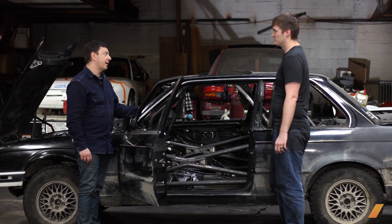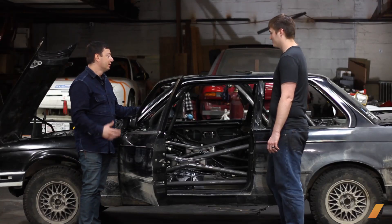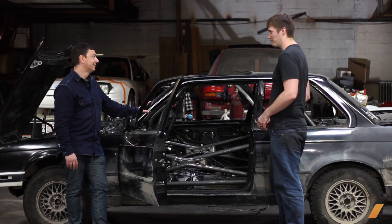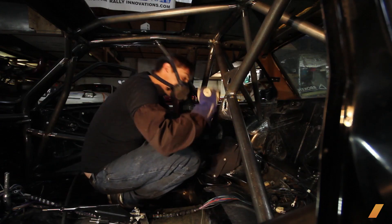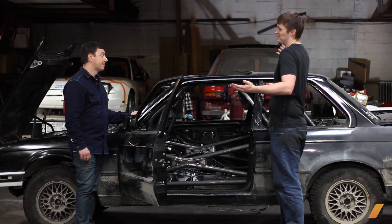Chump Car's safety approach is countered with lower cost — they use thicker bars but a less complex structure. In rally, cars rolling is kind of a regular event, so they really consider passenger protection equally. What makes this more of a rally cage is essentially making it completely symmetrical. A lot of road racing rulebooks will spec out a certain door bar design only for the driver's side — nobody on the passenger side, so they don't care. With rally, it's identical on both sides. And with the X bar in the main hoop, you're only required to have one diagonal for road racing, because there's only one driver — you only need the extra support on that side.